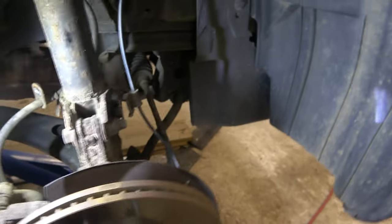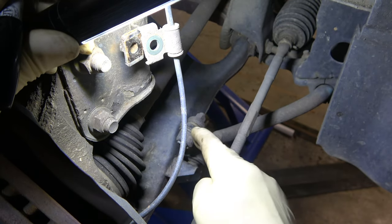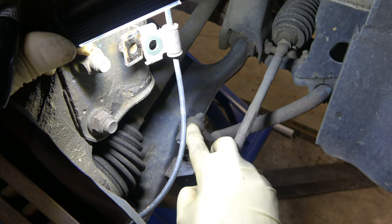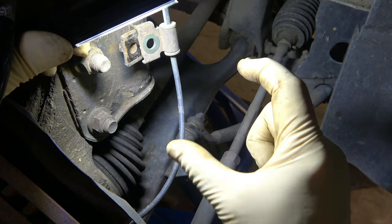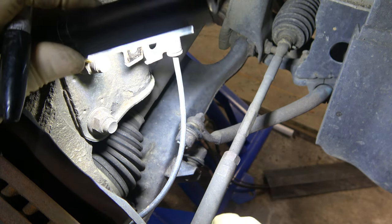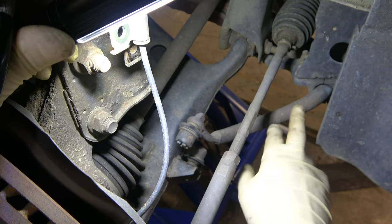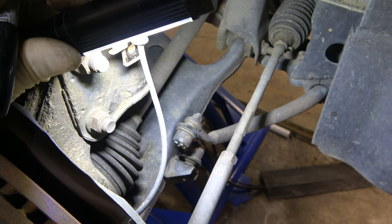I'm going to remove those two. Before I move on, I want to show you the last bolt we're going to remove because it's pretty hard to see. That is the sway bar link bolt. I'm going to pop the sway bar back and just drop it down. The reason you have to take this off is the tension that is on these control arms. When I put the spacer in the top, this arm is going to be sitting much farther down. It's preloaded at this height, so if I try to do that I'll be really struggling against the tension.